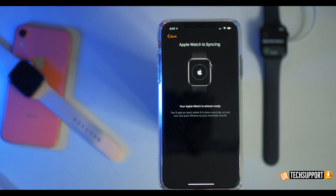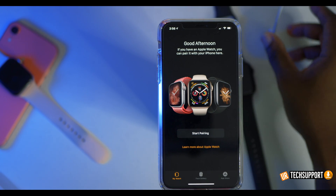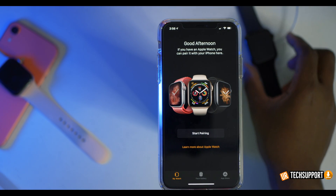Another really simple thing to check is power. A certain level of power is required for these devices to pair because there's a lot of information being transferred between the Apple Watch and iPhone, and it doesn't want one of them to die mid-transfer — that can corrupt data and lead to a whole other slew of problems. Check the power on both devices. If your iPhone is under 50%, it might not pair properly. If the Apple Watch is brand new and under 50%, it probably won't connect either.